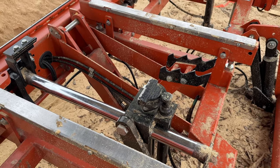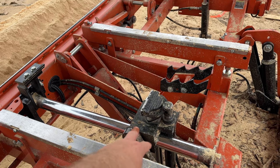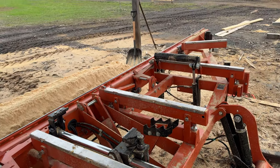I've talked with some of the guys at Wood-Mizer over time. You guys can argue this one in the comments below — can you over-grease? There are like 10 different grease points on the sawmill bed area. Justin over at Wood-Mizer in Georgia told me don't grease as much as you think you have to. He said this particular fitting — he's never really had a grease issue with one. Just make sure you hit it every 25 to 50 hours; not a big deal, just give it a shot every now and then.